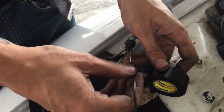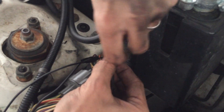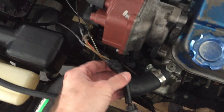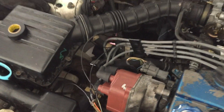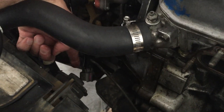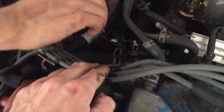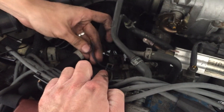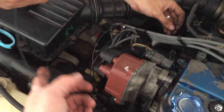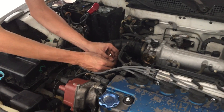This is what Juan has done so far — the newer connection with three wires, just taped with electrical tape for now to make sure things run correctly. He's using the white wire from the existing plug that was already down there and running it with this. Juan is using a ground that was already here — you probably remember it from the thermostat episode, it was just hanging off. So we're using that ground to connect the ground for the new O2 wire, which worked out great.